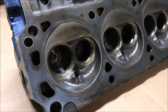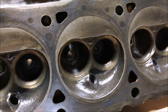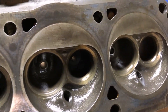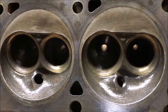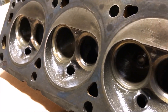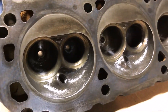This is our final product — as you can see the valve seats cleaned up really nicely. Although it did take quite a bit more work to get the exhaust valve seats cleaned, they're definitely worth it in the end. I also got the rust out of the intake bowls and smoothed out the combustion chamber a little bit. Right now I've got everything covered in oil so I don't repeat my former mistakes and these don't develop any more surface rust. The next step is to test them to make sure they don't need to be planed down.